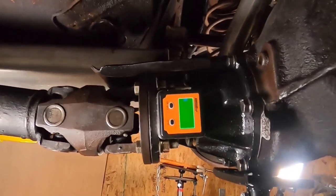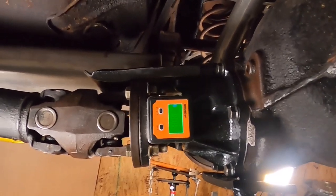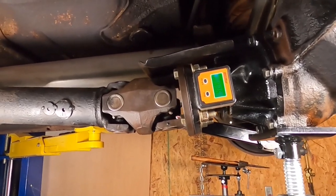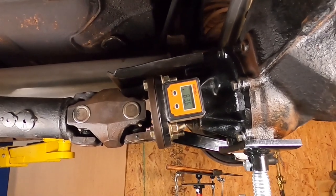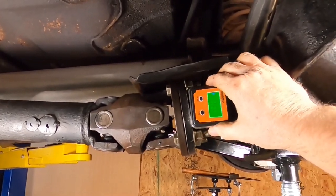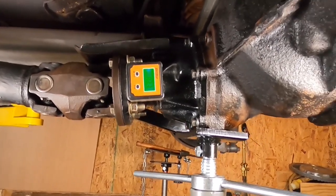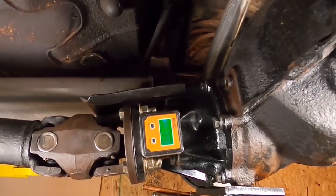The angulometer — the digital compass — says 83.6. That's four degrees off of where it was. It was sitting at about 79.5. I took four degrees of pinion angle out of it — it was down here and I moved it up this way. Let's take the tension off of the pinion. It'll probably sag a little bit. Now it's reading 83.3. I was shooting for 83.5, so close enough for government work. Let me get all the cameras and lights out from underneath this car, get it on the ground, roll it around a little bit, and let's see what our new angles are.